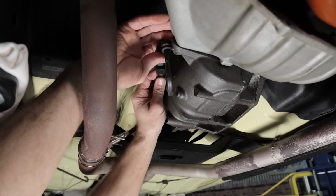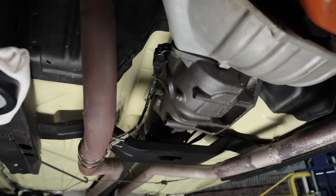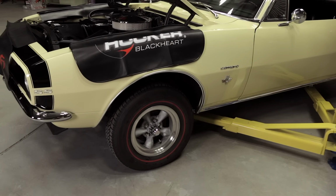Connect the O2 sensor to the throttle body and secure the wires to prevent contact with moving parts and high heat areas. Now that we've got the oxygen sensor installed, I'd like to show you just how simple it is to wire Sniper EFI. There's only 4 connections you'll have to make: battery positive, battery negative, a switched 12-volt ignition source, and your coil input.